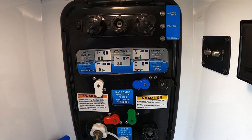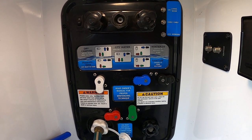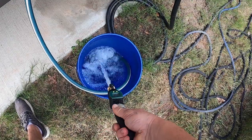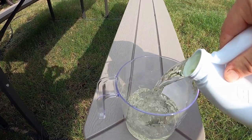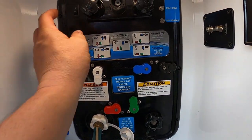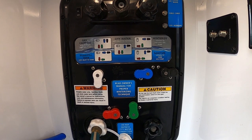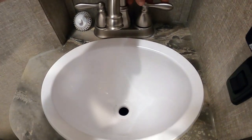The difference between winterize and sanitize mode is: in sanitize we pump from our bucket to the freshwater tanks, and in winterize we pump from our bucket to the fixtures throughout the RV. We have our bleach and water mixed. We're going to verify we're in the winterize position, turn the pump on to prime and pressurize the system, then go inside and turn on each faucet throughout the entire camper — both hot and cold — until we smell bleach water running out, ensuring all water lines are sanitized. Starting in the rear bathroom sink.